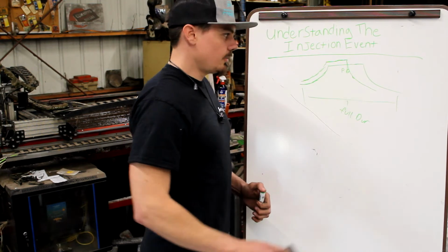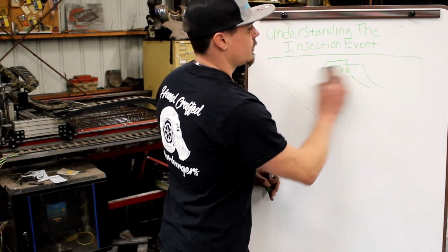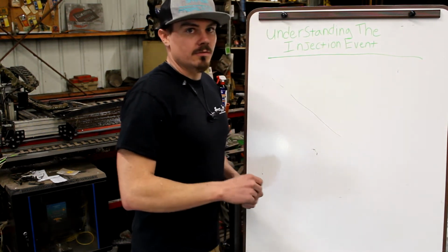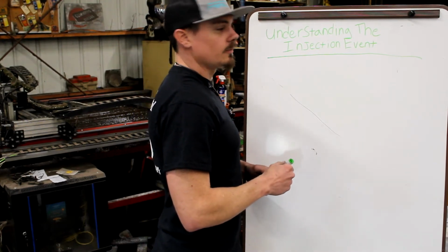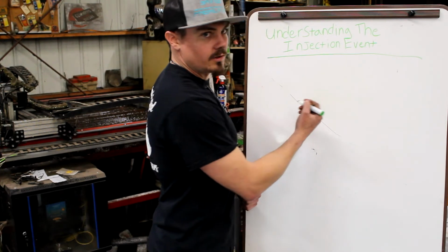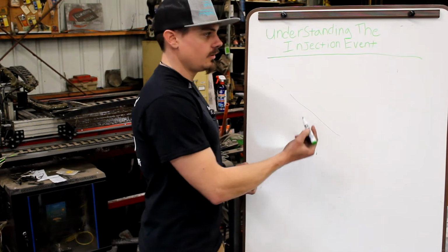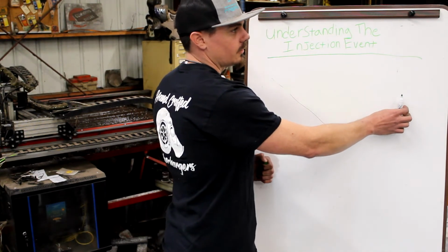The other thing to consider too is we talk CCs a lot, but we never talk about at what RPM we are making those CCs. So we talk about refill times, stuff like that, but they never talk about what RPM it's making those CCs. So like on a VE pump, say we bought a VE pump and it flows 270 cc's. It does not flow 270 cc's at idle. It also doesn't flow 270 cc's at 4,000 RPMs.